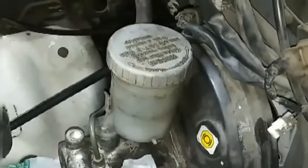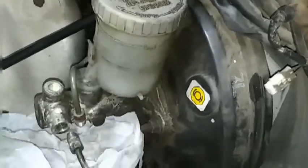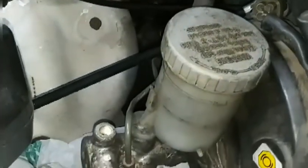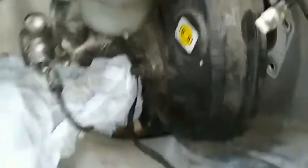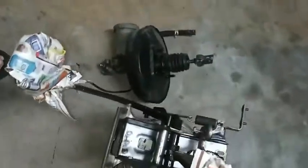Removed the cap. I took a syringe and drained all the fluid out of it. The lines are 10 millimeters, so clean them off really well so there's no chance of slipping with the wrench and rounding off the nuts. Then with a 10mm removed them. I also had to remove my old alarm siren so the brake booster would clear, but it should pull right out. Disconnect the electrical connector and the hose to the brake booster as well. Brake booster out of the way.